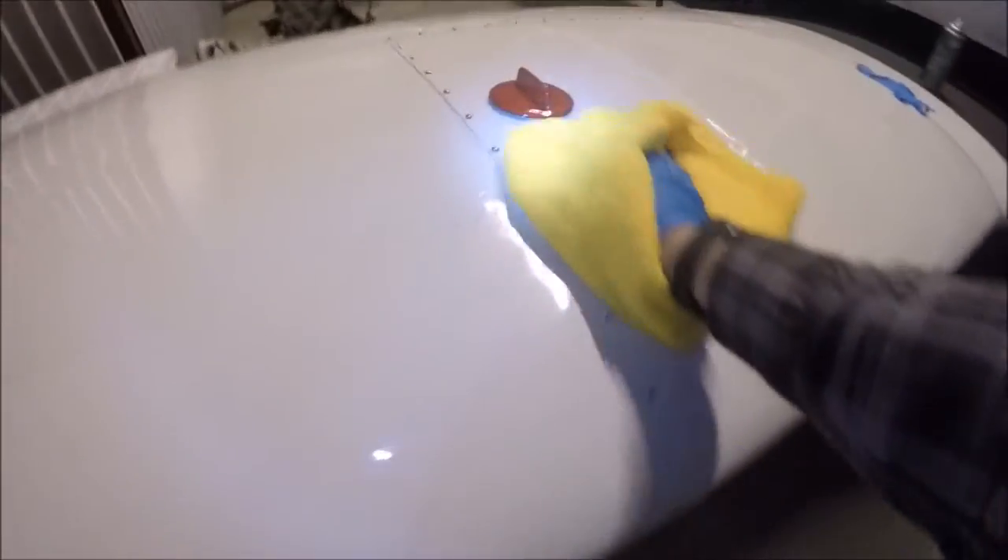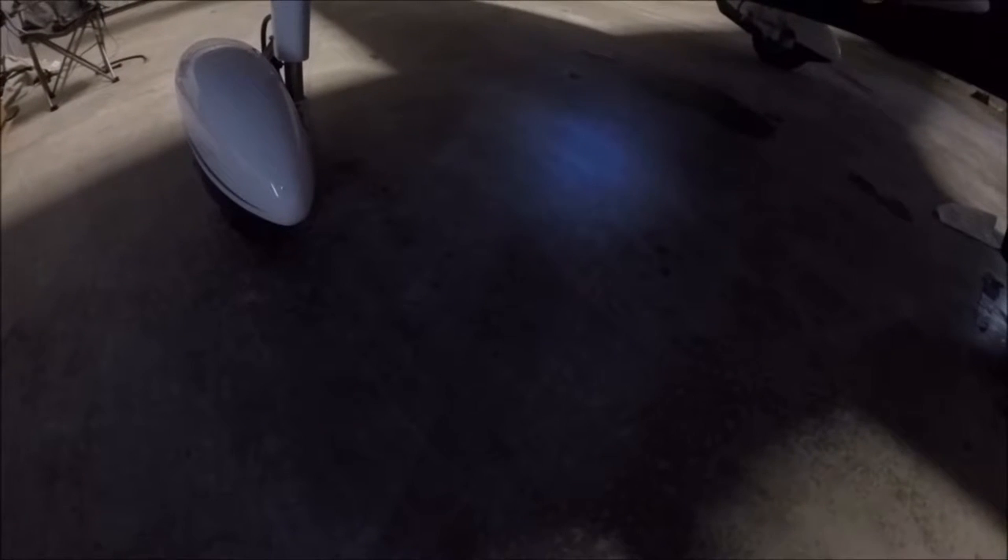Door is open, that is fine. Checking down here — flap is still secured, still hanging on. Piano wire is still good for my right aileron; up and down looks good. Going to the edge, checking the light. All the way down until I hit my fuel fill on the right side — look down, looks good to go. Moving down to the tire — wheel looks good, lugs look good. That also goes for visual inspection of the brakes, the brake lines, and the hydraulic fluid, making sure everything's in line. On the last side, something a lot of people miss: the internal air vent. Just about every aircraft has one — make sure that's free and clear. Normally it's overlooked, but if you're cleaning the leading edges of your wings, your hand literally goes over it and often stops from the friction.